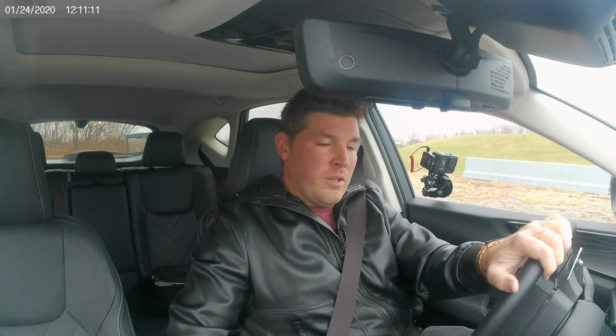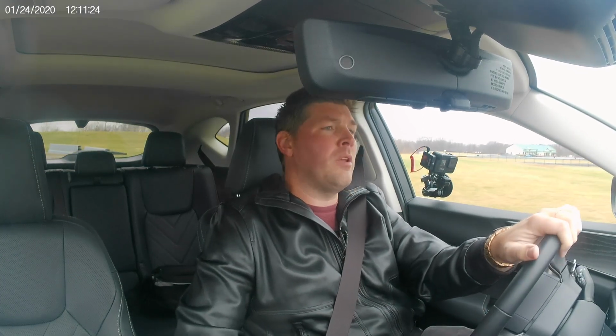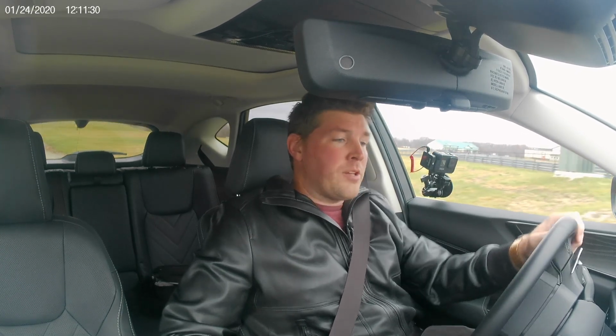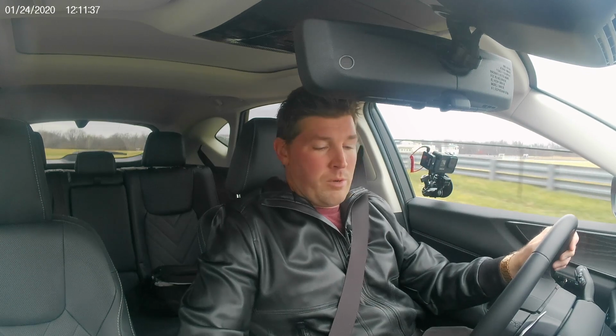So with this car, when you first start off, pretty much in any drive mode, it's going to be all electric power if it has electric power in its reserves. Right now, I've got 16 miles. I've utilized a little bit with some running around back and forth to this photo location, but you will start out almost always in electric mode. However, when you press and hold that charge button, the gasoline motor is going to turn on. Now you are charging your electric motor as you are driving.